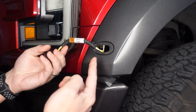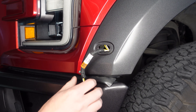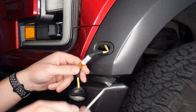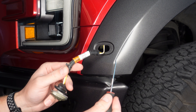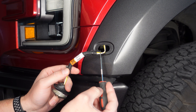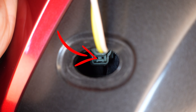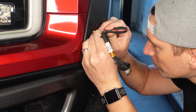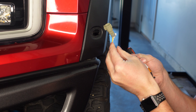Now I'm going to get you a new angle to see the wire connector inside of the hole. Basically the idea is we're going to use a pick to press the tab on the wire connector, and we'll be able to pull the entire assembly out with the wire connector, which fits through the hole. Here is a look at the plug — we'll show with an arrow on the screen the tab that you want to depress in order to release the light from the plug. I'm going to do this just using a pick.